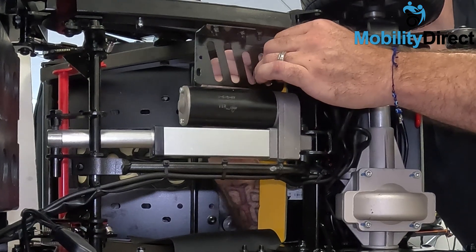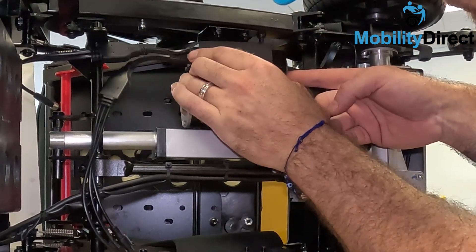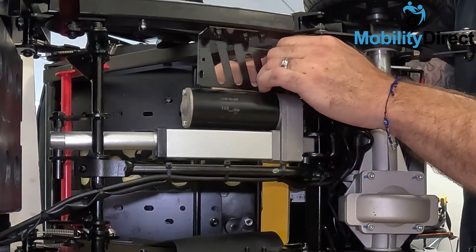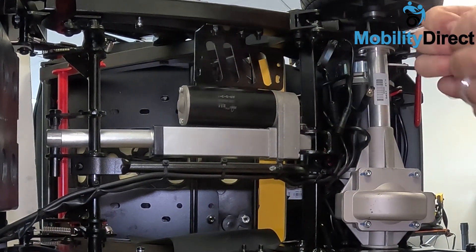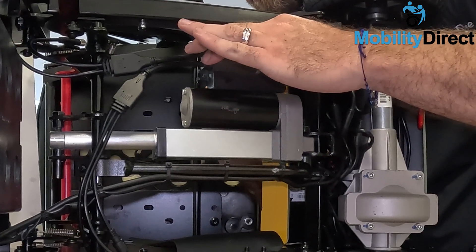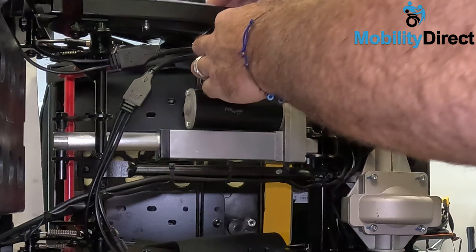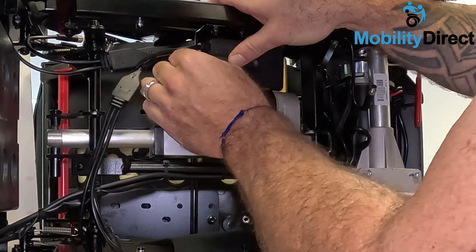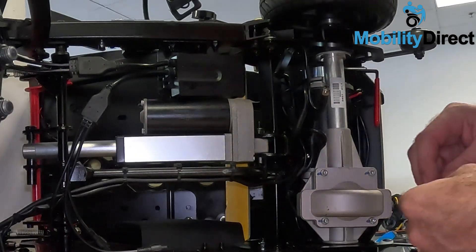Again, this is a folding scooter — an automatic folding scooter controlled by an actuator — so if your wires are incorrectly placed you will damage your scooter further. What I'm doing here is putting one side — one screw and one nut — in together so that I can slide the controller into place, and then put the second screw and nut in place. Make sure when you are tightening up your screws and nuts that you don't over-tighten — you don't want to break the housing on the control module. Once we have everything in place, go ahead and move to the second screw, align it, put the screw in, tighten it up, and put the nut on the back side with your pair of pliers and get it all nice and secure.